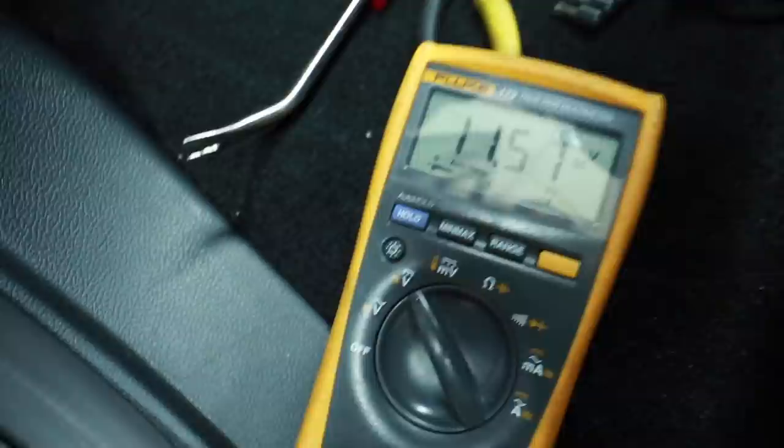The last thing we want to test is the remote turn-on. We want to make sure that it works and has 12 volts of output. This automatically wakes up as soon as you do things in the car, so we don't necessarily need to turn the car on to see if it's putting out voltage. Blue wire goes to red, black wire goes to ground. This is what we want to see — this is what's going to turn on our amplifiers. Now the fun part starts. We've done all the testing, we've seen how it works, it's going to be no surprises, which is what I like.